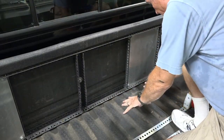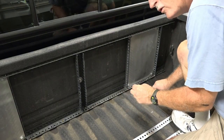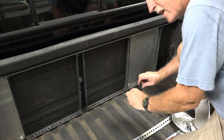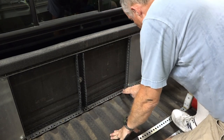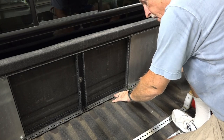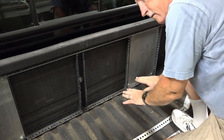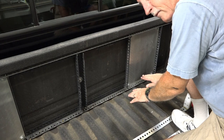My plan to fix this problem is to get a thin piece of steel — a high-yield strength steel so it won't flex and won't deform as easily. I don't want to get a thick piece of steel because it'd be too heavy, so I want it as thin as possible. I'm going to stick it under here all the way up to the front of the bed and across. Then when the camper is on here and porpoising, the weight will be spread over a bigger area and it'll go right over top of this bolt. That's my plan to make this much stronger and more robust. So let's go get some steel and get it ready to install.